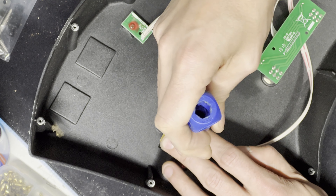And would you look at that? That's enough, but it's a little bit too much. So trial and error — you saw how little I turned it. Still a bit too easy to press. Let's tighten it a little bit more. What I'm looking for is for it to just barely engage. I want to have to apply force to turn that tuner on or to engage that wah pedal. It's not doing anything, so I think I just need to barely turn it just a little bit more. Still not enough, so I'm going to turn a little bit more. And there you go — there it is.